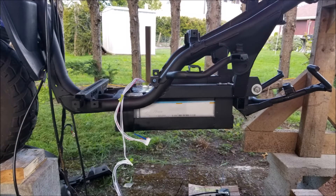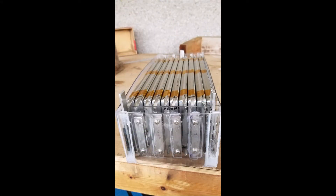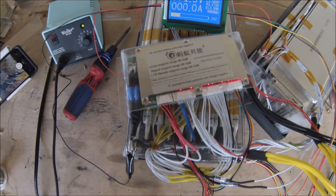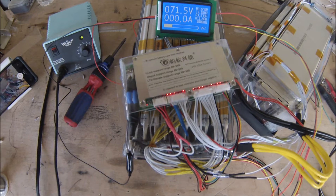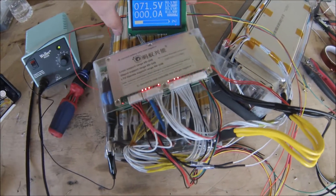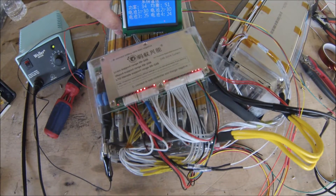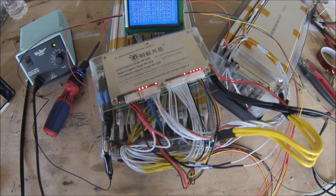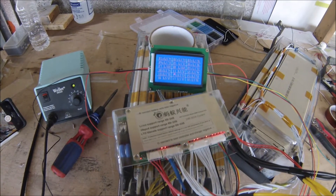The tabs on the pouch cells were made from copper and aluminum. I decided to go with aluminum strips that I used to sandwich the corresponding positive and negative tabs together for a 20-cells series configuration. This gives me a battery with 72 volts nominal and 60 amp-hours. The BMS that I chose was from AliExpress and features Bluetooth connectivity that allows for an incredible amount of control and information to the user. I have tweaked the settings to allow me to only charge to 82 volts max instead of 84 — I copied this trick from Tesla and it is said to increase battery longevity.